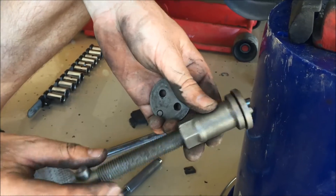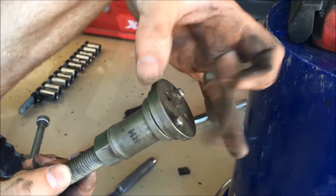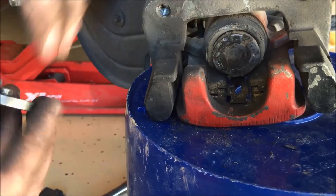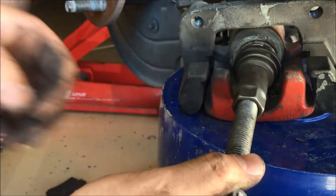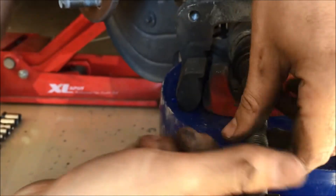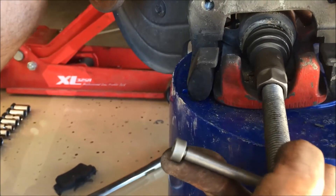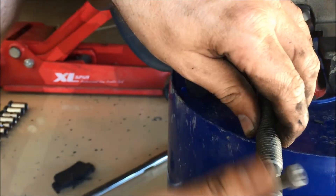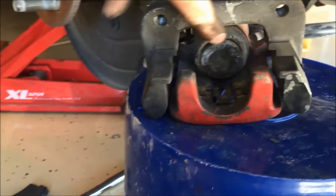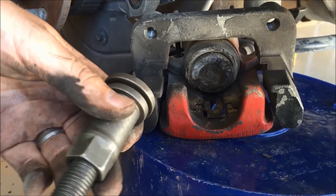This is the special tool you can rent from the auto parts store for free. You lock one of these pads onto it — it's magnetic so it holds in place. This piece locks into the two grooves on the piston. As you turn it clockwise it will compress that piston back in. Make sure you have the cap off the brake master cylinder reservoir. Turn it clockwise and it will draw the piston back in — compress it until it's pretty much flush. Be very careful of the outer boot. Push it all the way in until you can feel it stops turning.